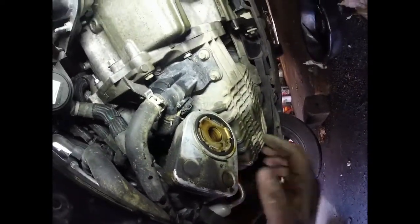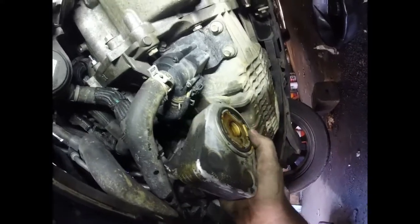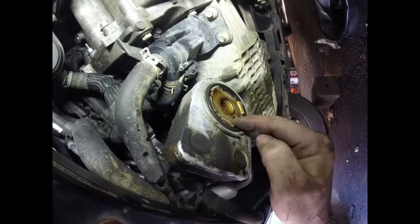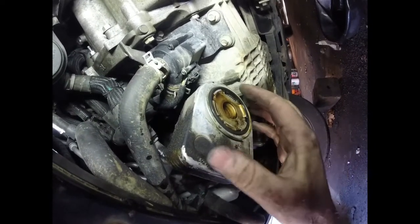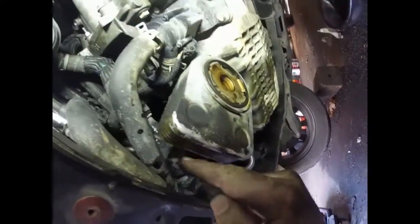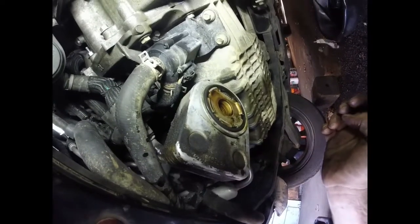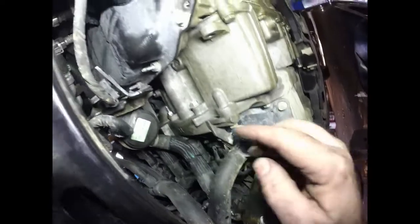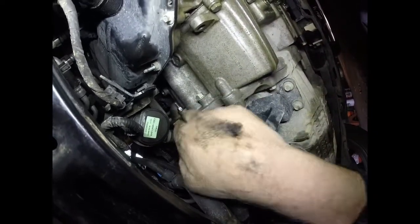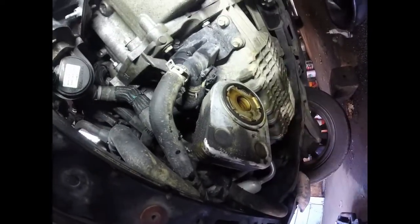Before you can even get to the starter bolts, you really need to remove your oil cooler, which is right here. This normally sits up in here. So you are going to have your oil filter — take that off first — and then take this oil cooler off and remove it out of the way because you cannot get the starter out with it still bolted up. I wouldn't take the cooler lines off — you can get the starter out without taking the actual cooler lines off, otherwise you are going to lose coolant. You can move it away enough to remove the starter through the hole. So there are three bolts total holding the starter in — two 13mm underneath and the one going through the block from the top. Then you have got the bracket with two 8mm nuts, and a cable ground that goes to this.